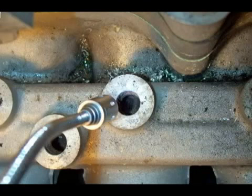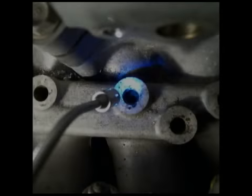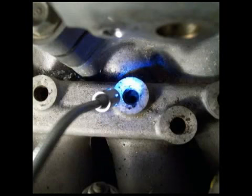If you completely disconnect the EGR valve, you're going to get a check engine light. You may get some spark knock. Severe spark knock is called detonation, and detonation destroys pistons just as if you took a hammer to them. So you need to leave the EGR hooked up so it'll pass the emissions test and not ruin your engine. This hole was open on this particular port.